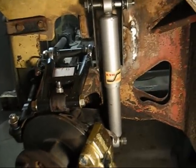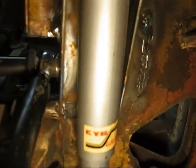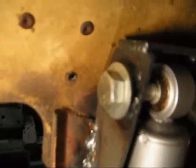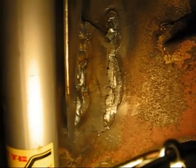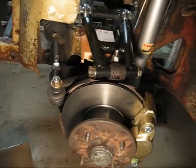This is the finished, modified, custom suspension. The shock tower up here is welded to a double thick plate that was on the Sprite to begin with, so I only welded to that. I figured I wasn't going to get much structural integrity out of that inner fender well, so I attached it to existing rigidity. You can see the ill-fated weld that I had to cut out and redo. But it's done. Now I just need to pop the spring in and I can put some wheels on this thing.